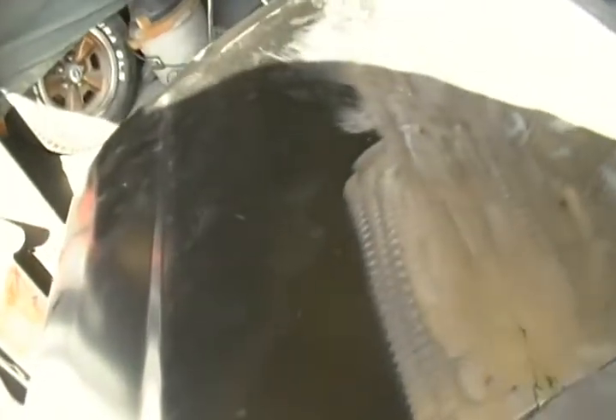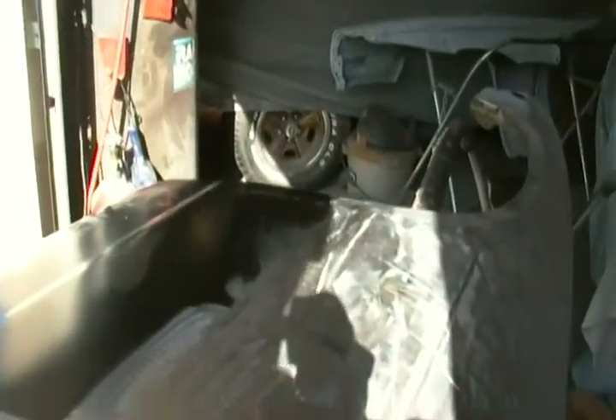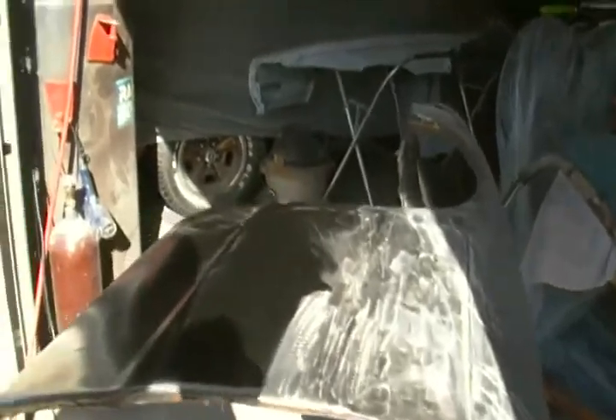Now I'm just gonna fill it with Dura Glass. I want to sand all this EDP coating — I didn't try it to see what was actually painted on, if it was actually coated the way they usually do it — but I'm just gonna scratch it off, hit it with Dura Glass, and call it a day.